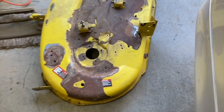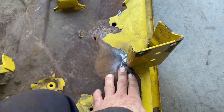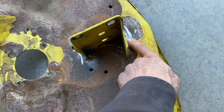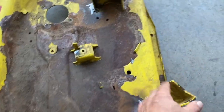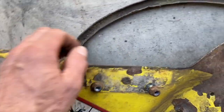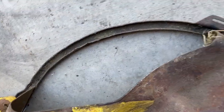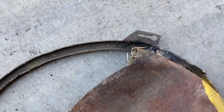So this next day working on the 135 John Deere, we're working on the deck. I welded a few spots here that had a minor crack — they usually crack here, and of course there and there. It's also welded underneath. I also beefed up the weld here and here too, because these things don't last long — they get smashed on trees, they get strain here, and they usually crack. So it's all welded up. Now I'm going to put the mini grinder to it.